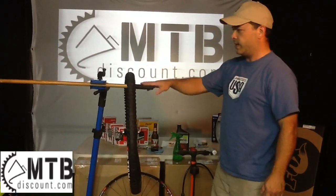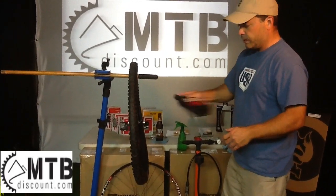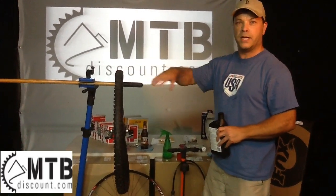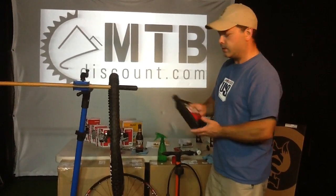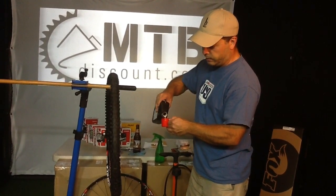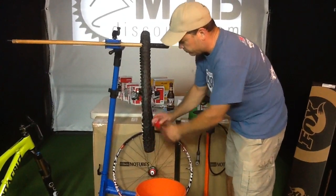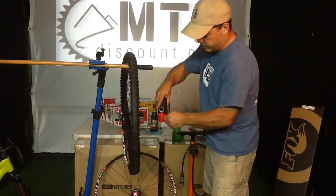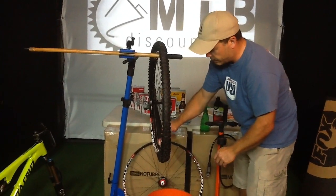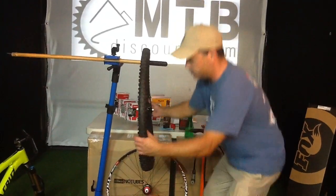We're going to take our Stan's sealant and shake it up real good. You've got to make sure that all the material is dispersed throughout and you get enough in there to help create a seal. A lot of these tires now are tubeless ready — they'll bead up fine and actually hold air reasonably well without the sealant, but the sealant's nice in case you run over any thorns, sharp rocks, anything like that. I'll use a little bit anyway. I'm running about a cup and a half of the Stan's sealant — just place it into the bottom here. Make sure the material stays suspended in the cup, and I just kind of rinse it out to make sure we get any of the heavier materials in there, because that's actually what clogs it all up for you. Once it's in there, you basically just have to bead up the rest of your tire.